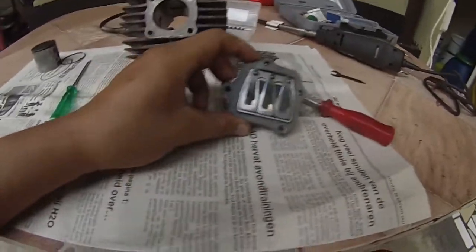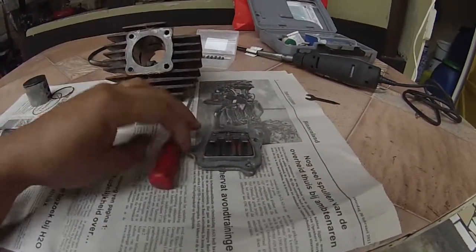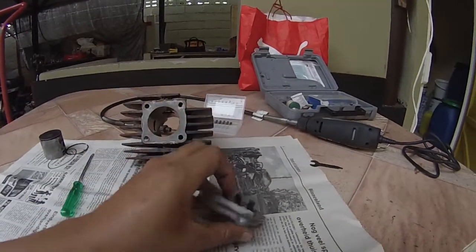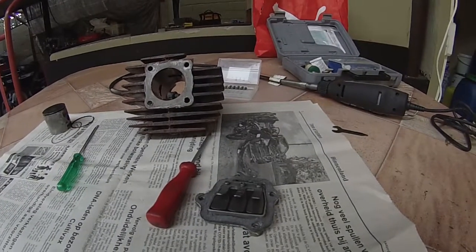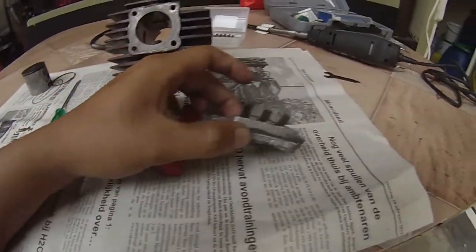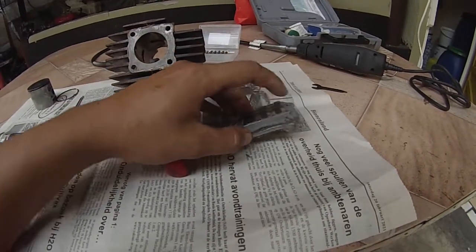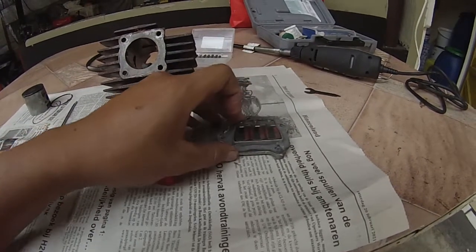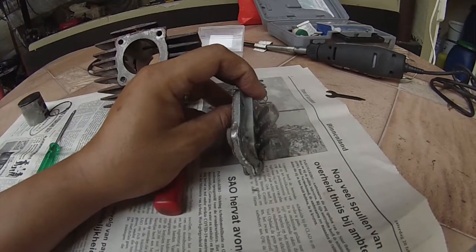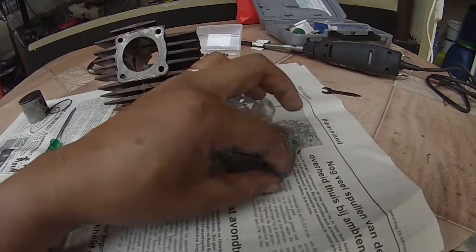Okay, a little tip and trick on tuning the reed valves for better fueling. This is called the reed valves — these are the reeds. Every stroke this thing opens just like this to let fuel in. The best way to tune this is with these reed holders. You have to tune it based on how much pressure it applies to the reeds. The more you press down, the more pressure it puts on the reeds, but it also takes longer or is harder to open. It has to be tuned until it whistles — I'll show you in a sec.